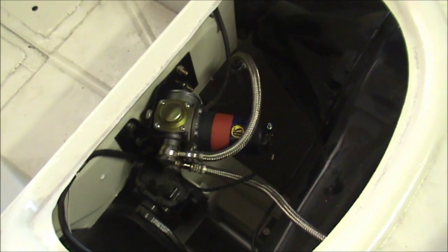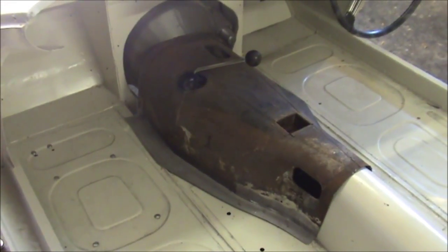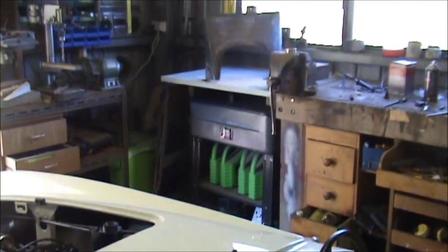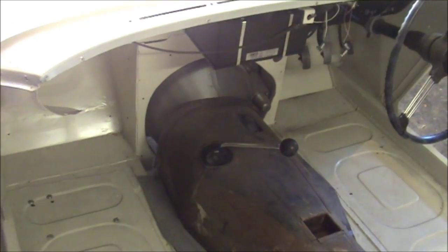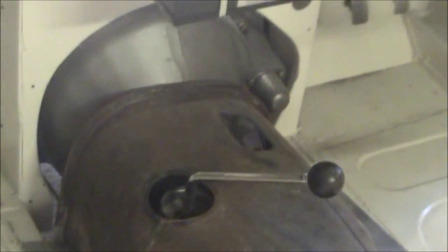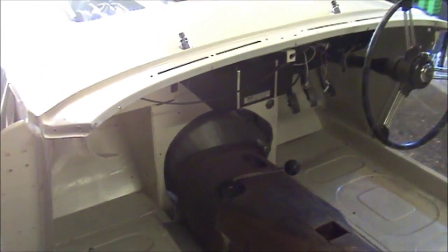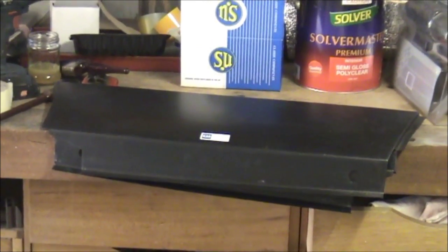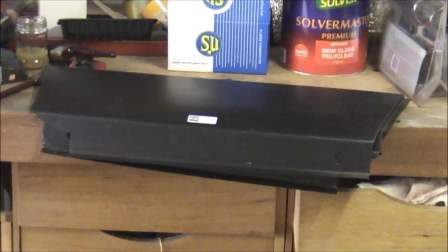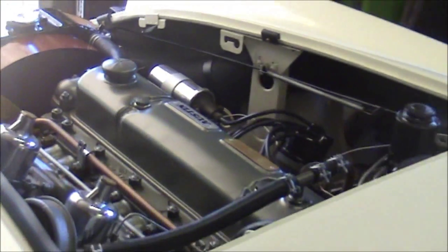So that's probably the progress so far - not a lot to tell, just a few little bits and pieces. There's that section I welded up last time which has got to be cleaned up, de-rusted and painted, and this little piece here which fits over the gearbox housing. The next step is to finish painting the bonnet and the boot, which I have in primer but the weather got too cold to put top coat on. I also have some repair pieces from Kilmartins for my front guards, which I'll show you when I come to do some cutting and repair work on the front guards - that's probably the next bit of major welding I'll undertake.